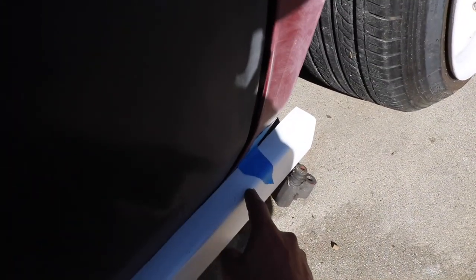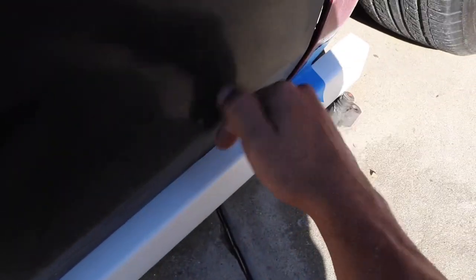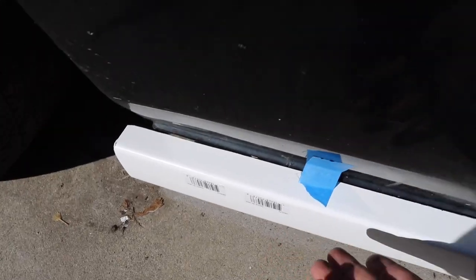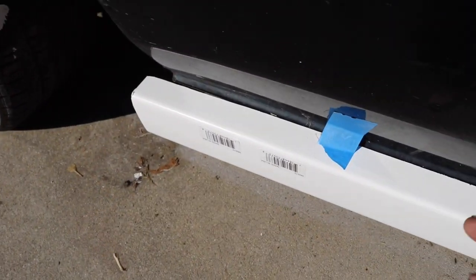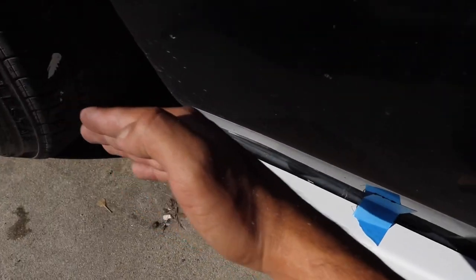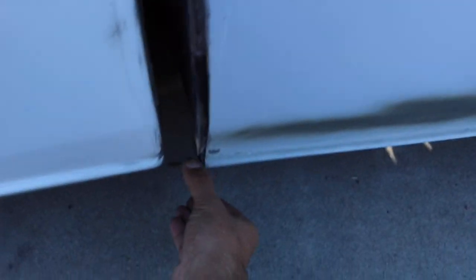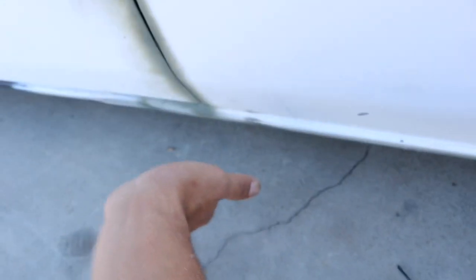Right where the door stops, probably about an inch, I'm going to cut back a little bit — same with the fender, cut back maybe half an inch to an inch — that way it can push in and this little lip will sit inside the door jamb. I also have to throw on the bedside. My theory is right here I'm probably not going to cut anything, but back here it's going to be cut all the way to this face and then angled so it flows with the shape of the bedside.